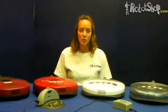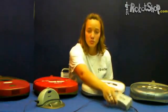If you see that your robot's cleaning time has been diminishing and your robot is cleaning for less than 20 minutes, or your robot's charge time is less than the normal 2.5 hours with the fast charger, or less than 7 hours with the standard charger, it may be because your Roomba's battery is deeply discharged. In this case, it may need to be charged for a longer period of time. This is a good time to try the Roomba Battery Reset Procedure.